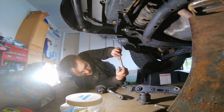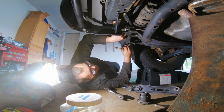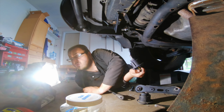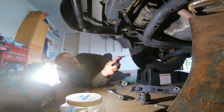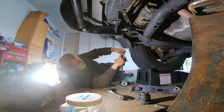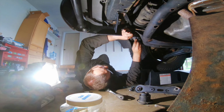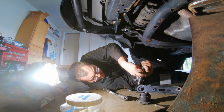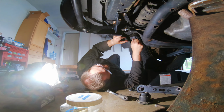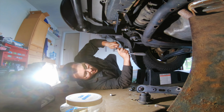You're gonna grab your subframe bolts from the car. You're gonna grab your bushing, orient this arrow towards the front where there's a hole, just like so. Okay, and then before you do that, you wanna lube it up. I'm using the WD-40 silicone. Okay, that's done. Orient arrow towards front hole. And then you basically tighten. You'll hear creaks and snapping, that's normal.